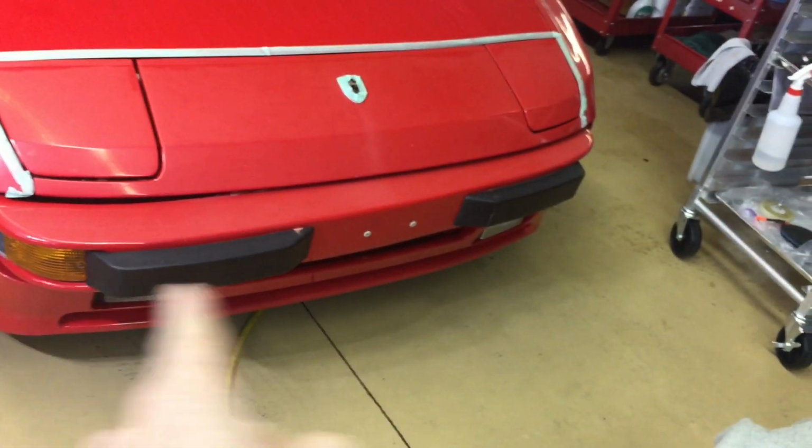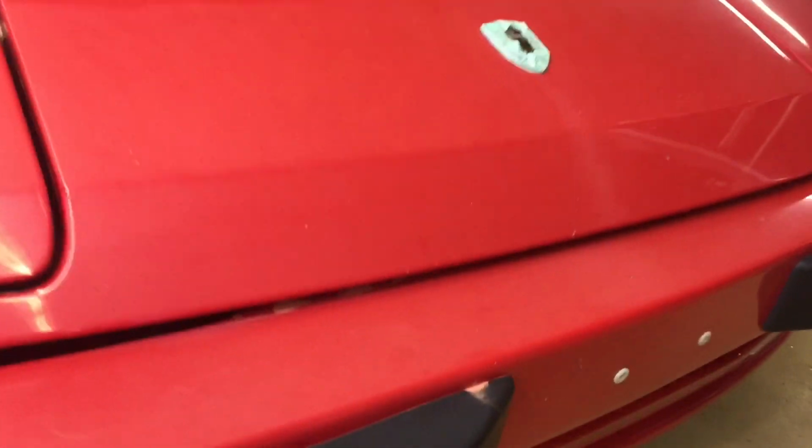Today's video will start working around the headlight lids and surrounding areas. We'll use 5000 grit to knock off some of the dead paint there. Not quite as bad as the hood or the roof. As we get to the bumper and below, as you can see here, the corners are worn very thin. Very little product, very little finish here. We're going to be careful. We're just going to polish. We may even just hand polish.